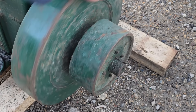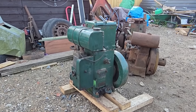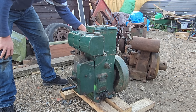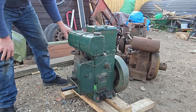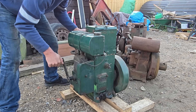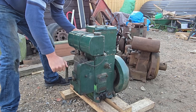She's got compression - I reckon this might run! The petrol is switched off and it's reverse rotation. Let's go open - three quarters of a turn because it has a screw stop. Let me get cranked and lift that cold valve. That's probably how he couldn't get this going - that cold start valve hadn't been lifted. That hasn't been lifted for a long time.